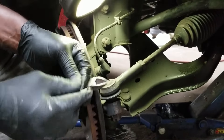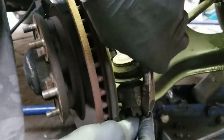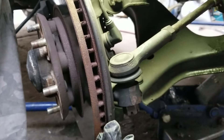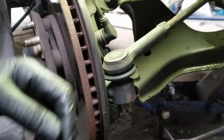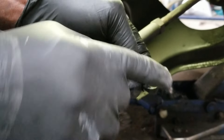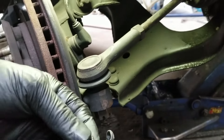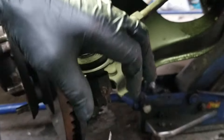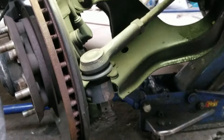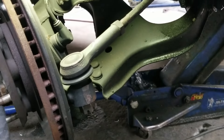I wrapped the wire cutters onto the part sticking out through the castle nut, grabbed onto it, and just pried against the knuckle and it came out. There's a special tool — something like a pick with a hook on it — you can stick through the hole in the castle nut to get it out. But you have to straighten the end first because the ends have been turned over to lock it so it won't come out.